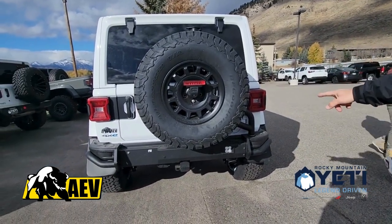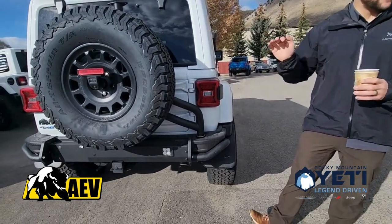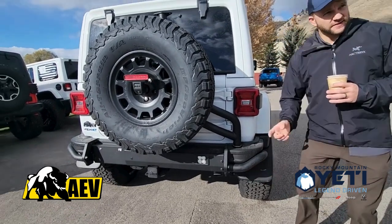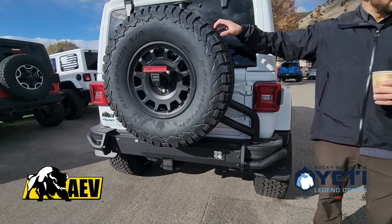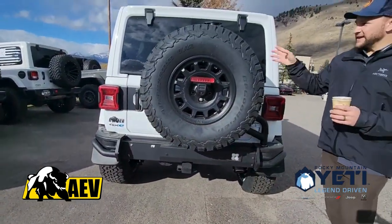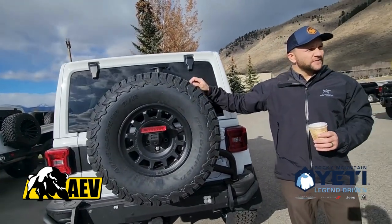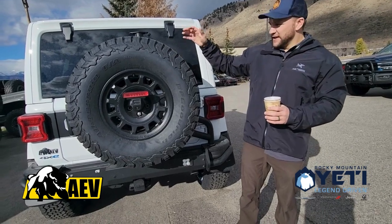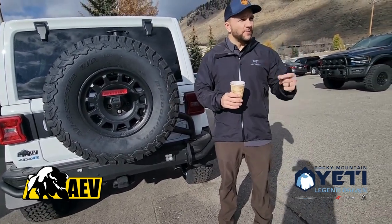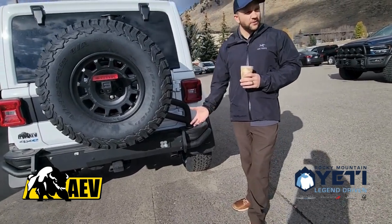In the back, you've got the tire carrier and rear bumper — and it's important to note they're separate pieces. The tire carrier isn't even mounted to the bumper; it passes through it and mounts directly to the frame. With a 37-inch tire that's about 120 pounds, and we also make a fuel caddy that mounts behind the tire carrying 10.2 gallons of gas — about 70 more pounds. Call it 200 pounds sitting still; once you start bouncing off-road that force multiplies, so you'd be resting 400 pounds on a bumper with some bolts. Mounting it directly to the frame that's designed to support the weight is the right approach.